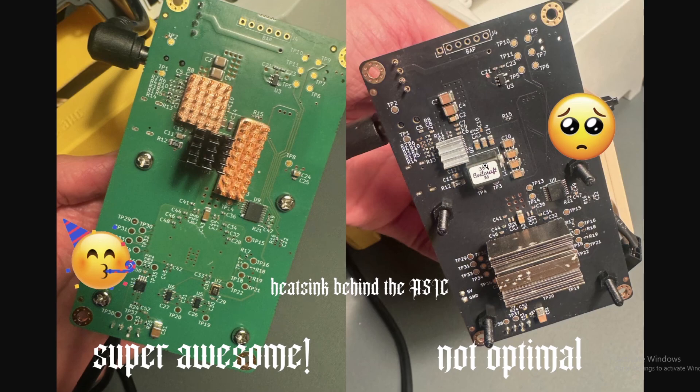On the back of the board, it looks like these chips should be covered. There's what I believe is the voltage regulator, and then there's something underneath that already has a heat sink on it. I also want to put one on the front — imagine this is flipped around — right here as well just to dissipate some heat. The power supply socket gets very hot as well so we might try putting some around there. We have quite a lot of them so we can test out a bunch of different configurations, and we're going to put some onto the Supra and Max in later videos.